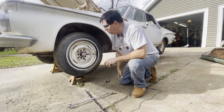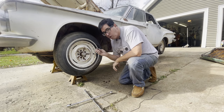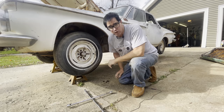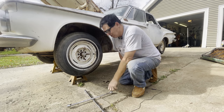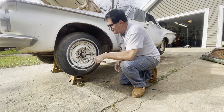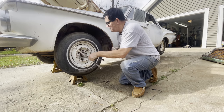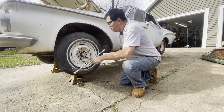As we all know, Mopars built up to about 1972 or so have left-hand lug nuts on the driver's side of the car. So the righty-tighty, lefty-loosey doesn't apply to these early Mopars up till about 1972-73 — it's righty-loosey. I've taken off a bunch of them here, and here's our heavy-duty 15 by 6-inch steel wheel, which was an option on the police car.